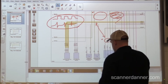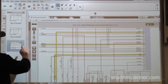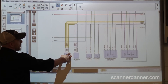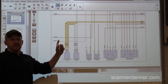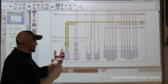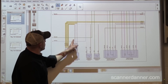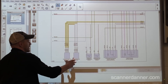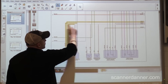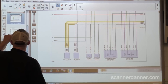Off camera I was doing some homework, checking what type of cam and crank sensors we have. The cam looks like a Hall effect to me by the way it's wired — notice they don't have the shield. They'll usually shield VRS-type sensors more than Hall effects. The cam sensor shares a wire with the fuel pressure sensor, suggesting it uses a 5-volt reference. The third wire is my signal — the green-and-violet wire — which goes back to my engine computer.